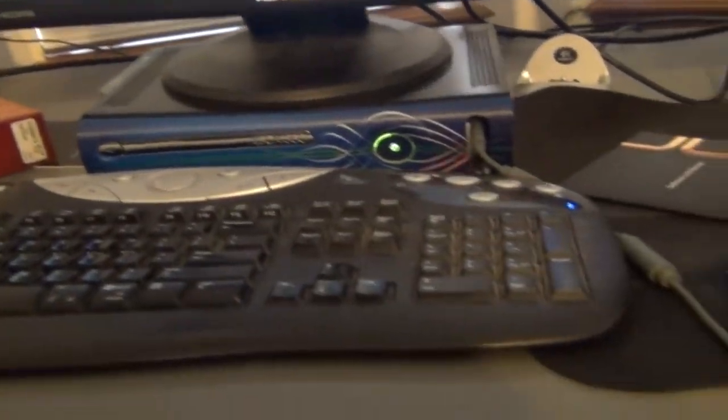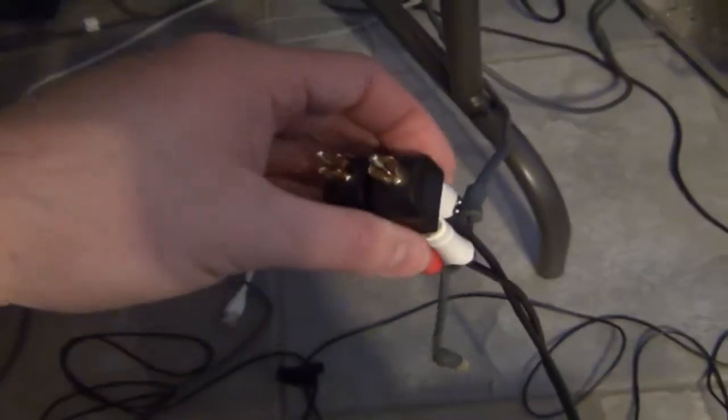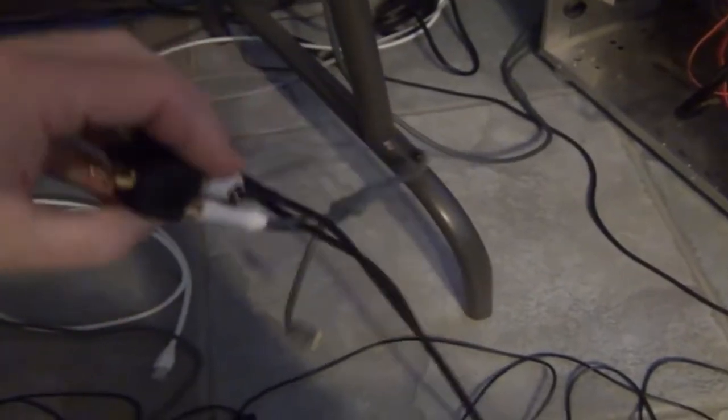I don't want to go by HDMI because I need to hook up the microphone for the Turtle Beach. To do that, I need a red white in. As you can see here, what I was doing was I was capturing in red white here, which breaks off through the microphone there. See, the red white goes from the recording to the black. Just a conversion comes here. I know the microphone works to this point. I mean, I've tested with other recording hardware, so I didn't plug these in. This is just audio, and it does work this way.